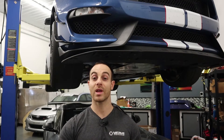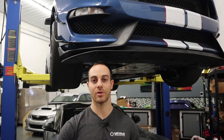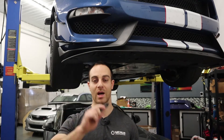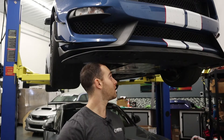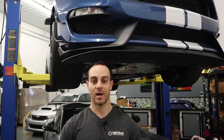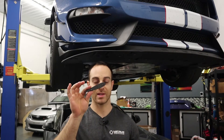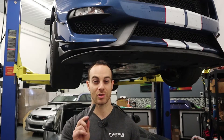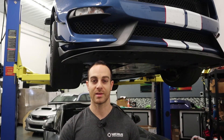We came up with a quick little solution. These are cut from our poly weave sheet that we use for front splitters — it is 12 millimeter thick, it is a carbon thermoplastic, so it is abrasive resistant and pretty strong and stiff. These little strakes will go on the bottom of the splitter and protect the factory plastic unit, which is quite expensive. They are the exact shape and size of our titanium units — these are less expensive to produce and should last quite a while, but if you seem to be going through them you can upgrade to the titanium units.